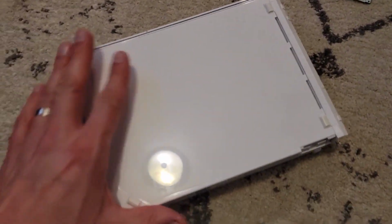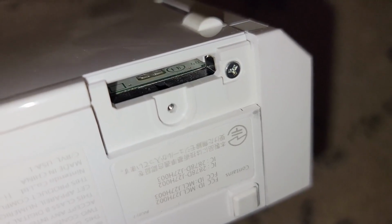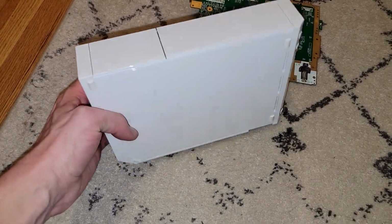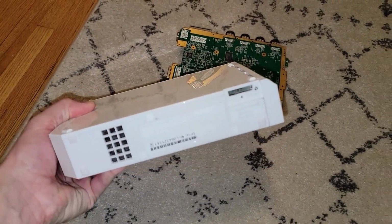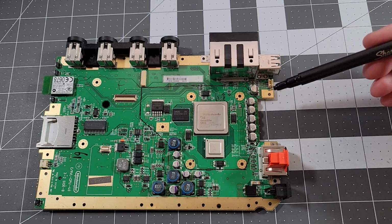I have a new Wii, and have confirmed it is a newer 4-layer board. At this point, since the preceding processes are exactly the same, I'll skip the modding and teardown and go straight to trimming down the circuit board with this new unit. I've outlined the circuit board region needed for the handheld mod, so it's time to harvest it.